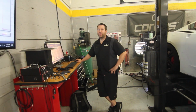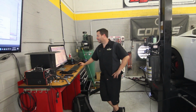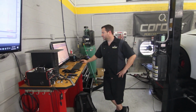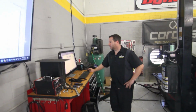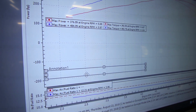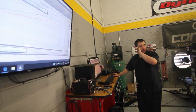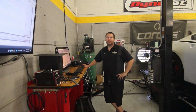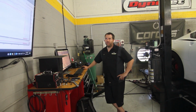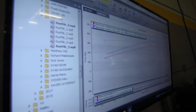Pounds of torque, basically. It's still fun. It's that old man blower. Does it take any more timing or no? Probably wouldn't benefit from pulling it up or anything? To pull it down? Yep, and that's only on 5 pounds of boost. It needs headers. Oh, I bet. Headers and a pulley. They probably take up like 35, 40. What do C7s with just headers put down? Headers and an intake will do like 420 to 430. Okay, that's a pretty significant gain, man.